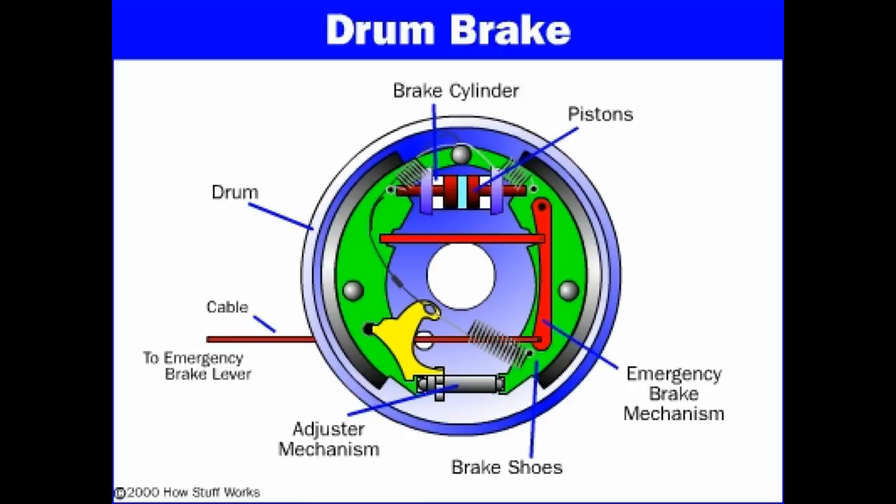Now when you're adjusting this, I'm doing the left side of my trailer. So if I'm sitting at the back of my trailer looking to the front, I'm doing the left side. Pretty much looking at the threads — if you can see the threads, you're going to know which way the toggle needs to move. So if the threads are on the right-hand side, you want to move it counterclockwise, so you want to go up. The threads for me are on the left, so I actually have to move the toggle downwards in order to go counterclockwise in order to loosen the brakes. And that's the way it works — for the other side, it should be opposite as well.